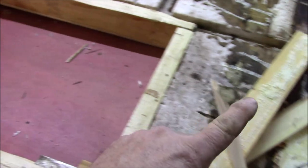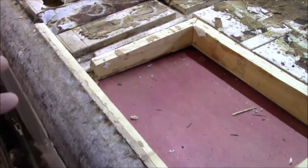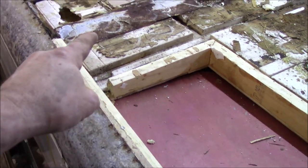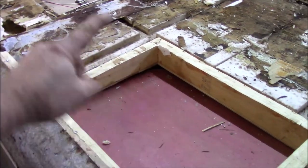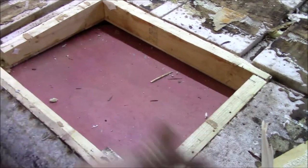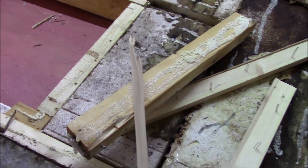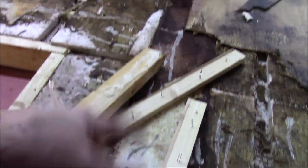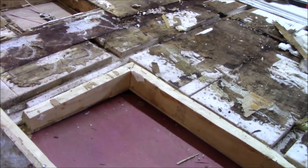We're going to try putting a vent over here that I designed — I've had trouble with these skylights before where folks complain about rot, and I've stewed over it. So now what we're going to do is put a solar fan over here, and on the other side put basically a draft vent, so when the fan kicks on it'll draw air across and pull the moisture out. It's solar-powered, so whether you're there or not, whether it's parked or whatever, it's always going to work — no plugging in required. Let's get to work on all this mess and get it cleaned up.